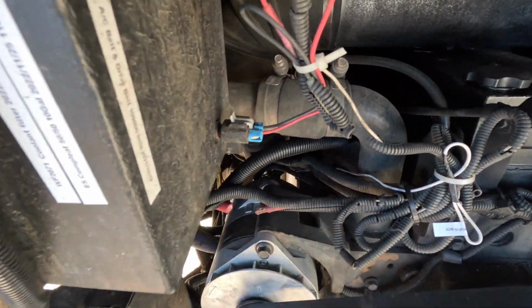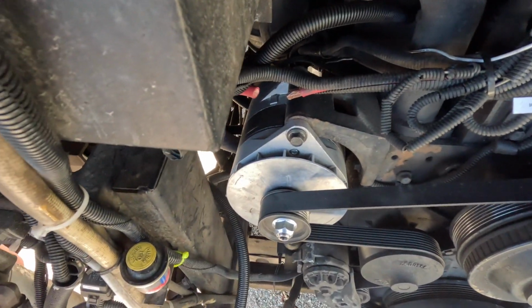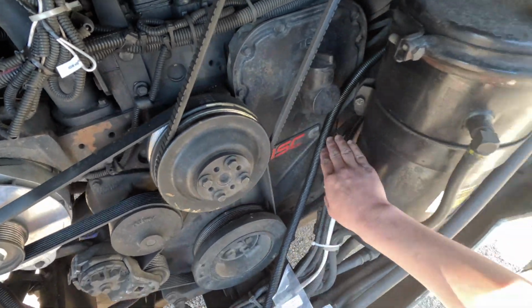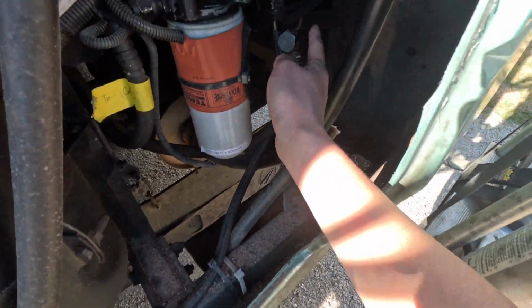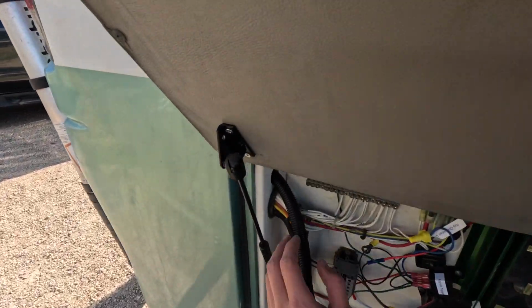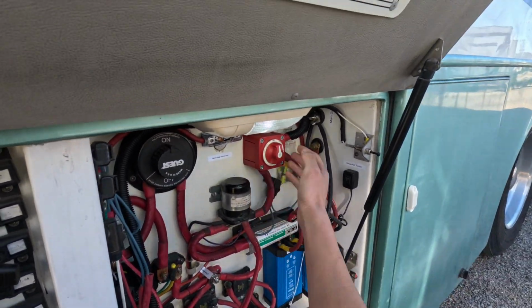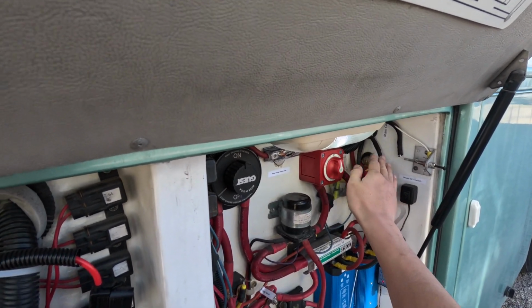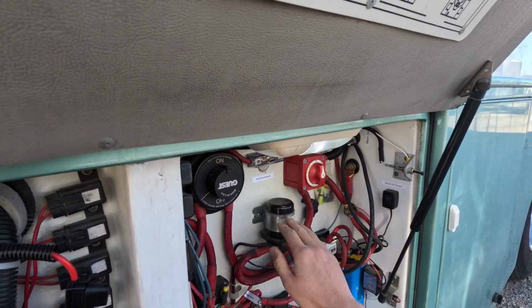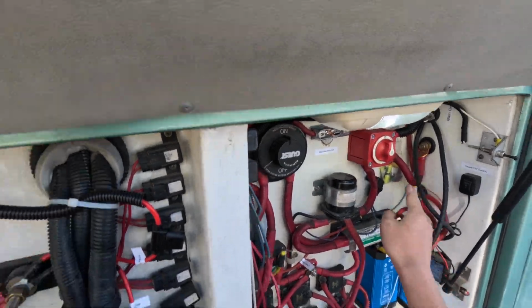not reached yet. Now this is one of the wires, because I'm upgrading to the bigger amperage alternator, so I need to run additional wire, and that's the 1/0 wire right here, and it's running from here through here and to a hole over there, and then it will reach. Alright, it's quite windy today. It will reach here. Now this is the new wire going from there to here, and then to this switch. And this side is the supply side of the chassis battery, and this is the outgoing side of the battery, but that's not important here. So I'm connecting this to this, which means it will directly connect to the battery itself.